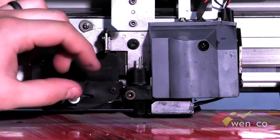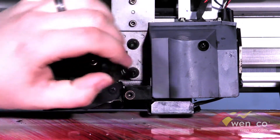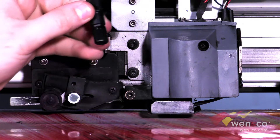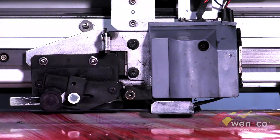To replace the contour cut blade all you are going to do is loosen this screw here. This unit should then just slide out. To remove the knife all you do is press this pin here. The blade should slide out and you can just pull the blade out from there.